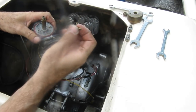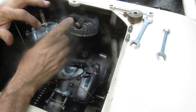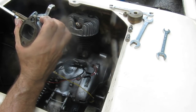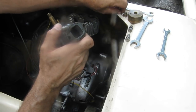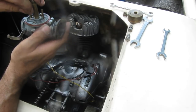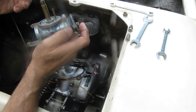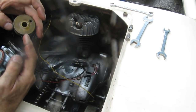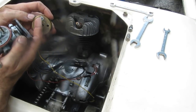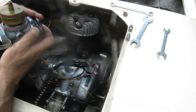First we'll put the pilot jet in. Now I did not take the pilot screw out. The pilot jet in, just turn it just snug. The inlet needle, put a pointy end down in the inlet there. Put the float back on. The float only goes on one way. It's actually marked bottom. Bottom is going to be up since the carburetor's upside down. And there's actually a reinforcing pad here where it sits against the float. The inlet needle, so put that on.